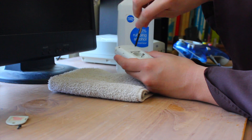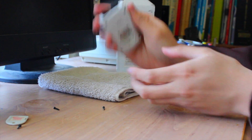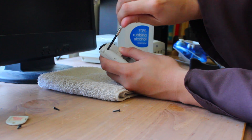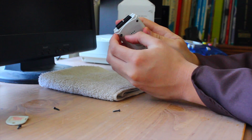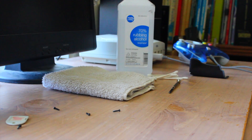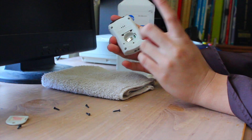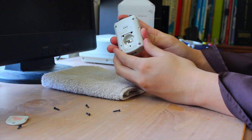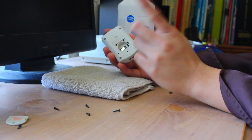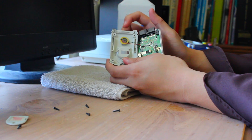Okay, so here is the last screw. Just gently try to shake these screws right off — they're a little bit hard to come out sometimes. Once you're done removing all five of those screws, this is the part that you need to be careful of. When you take off the lid of the back part of the Sega Dreamcast VMU, always open it like a book to the left side, because there is actually a set of wires connected to the back of the Sega Dreamcast VMU. The reason those wires are there is because this part is the speaker of the Sega Dreamcast VMU.